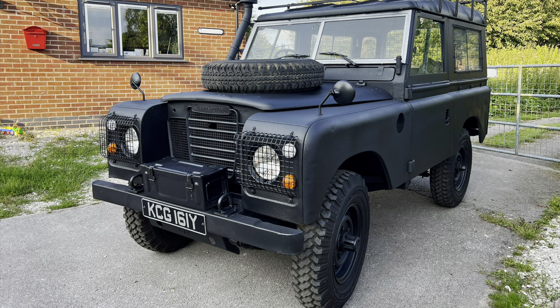The new head gasket is on and the head itself is now in place. I've put one bolt to this side just to hold it in place and put the rocker arm assembly back on. I've put all of the push rods into place, so as the rocker arms come back they locate into these — you want to make sure they're all in line all the way down. Now they're all in place, we can torque them down to the right setting — you have to check your manual for that. Then the rocker arm assembly is in place, we can take the jubilee ties off, let the springs come back out, and everything will be in place. The rocker assembly is now fully torqued down and the head is now fully torqued down on the new head gasket.